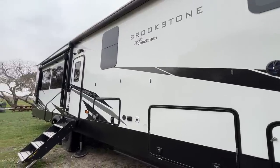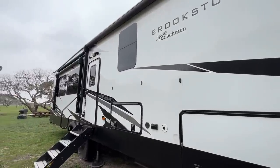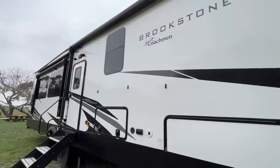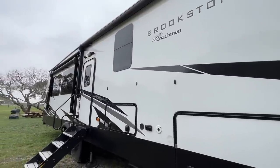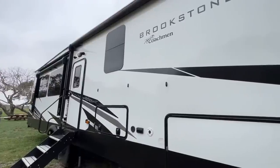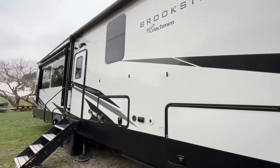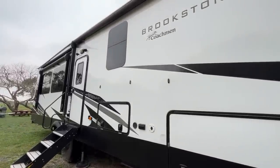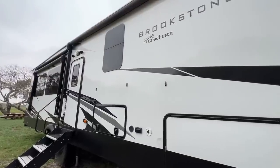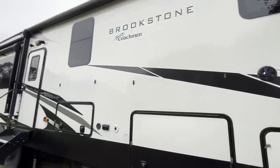The key message is: be very gentle when you wash the exterior of your RV. Do not use a pressure sprayer. Do not spray water up towards the bottom of your windows — let water fall from the top like a rainstorm. Use a very soft bristle brush to clean the side of your RV with the soap of your choice, just don't use anything too harsh or with detergents that could cause premature damage to the exterior finish. Then use that same shower effect to rinse your RV and get all the dirt you've loosened off.